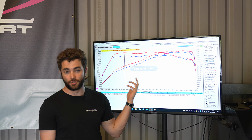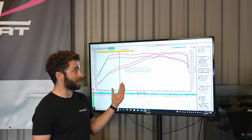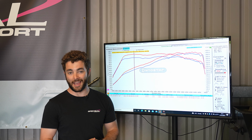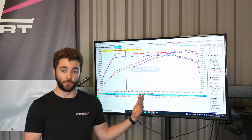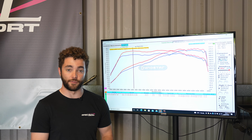You can actually custom tune with the JB4, so we're just going to figure that out because we haven't done it before. And maybe we'll revisit this video if we can access some of the higher maps with some smoother graphs, because it was actually making around 369 horsepower and just over 500 newton meters of torque. But like I say, the graphs weren't particularly smooth and it's something we want to obviously work with Burger Motorsports on and see if we can get that graph nice and smooth.